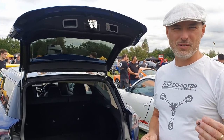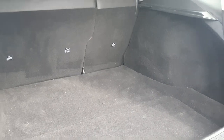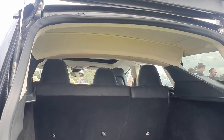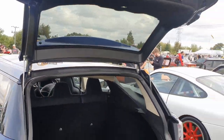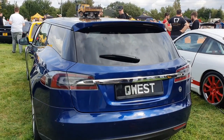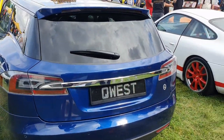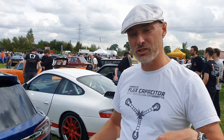Okay, that's a lot of development time — that's a great idea. And look at the space in here — it's impressive. You've got another 7.4 cubic feet of space and three inches of extra headroom in the back for rear passengers. None of the crash structure has been affected at all, and none of the electronics. In fact on the accessories CAN bus system we've actually got a rear wash-wipe, which you don't get on a Tesla. Everything we've added to the car is carbon fibre, bonded using 3M's aerospace epoxy — we had to do training courses for it — so it's aluminium-to-carbon-fibre bonding, just as they do in aircraft nowadays.